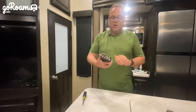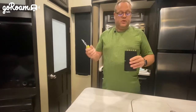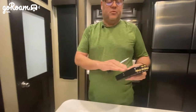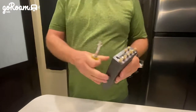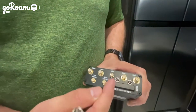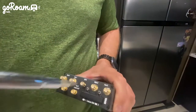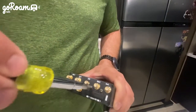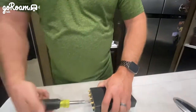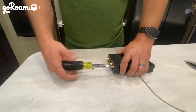Once you are ready to put your SIM card in, you will need a Phillips screwdriver — that's the only tool you'll need. Because this is ruggedized, everything's screwed together. On the very back there's a little door with two screws in it, and that's where you put the SIM cards in. Remove those two screws, and make sure you're over a flat surface so you don't lose them.